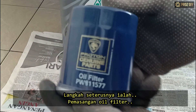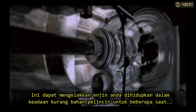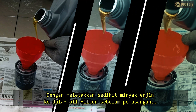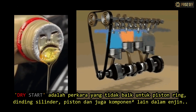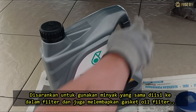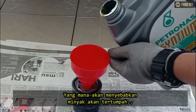The next step is to install the new oil filter. Before installing a new oil filter, I like to pre-oil the filter. This will prevent a dry start — when the engine runs without lubrication for a short period until the oil pump can generate sufficient pressure to circulate the oil. Oiling the brand new engine oil filter before you install it will help ensure that your engine always has lubrication from the moment it starts. Dry starts are just bad news for engine rings, cylinder walls, pistons and all engine components. It is best to fill an oil filter and use that same oil to coat the rubber gasket. The filter doesn't have to be completely full, especially if putting the oil filter in place will make the oil spill.